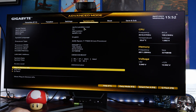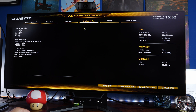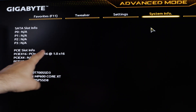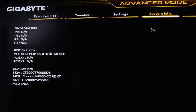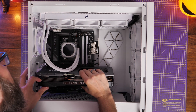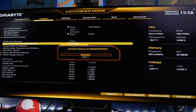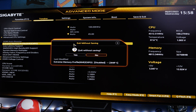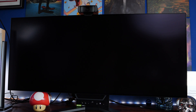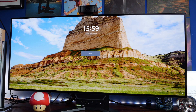If you go into system info, you can also see that despite populating three of the NVMe SSD lanes, the PCIe X16 slot is running at maximum lane speed, which is great. It's worth noting that you only get one X16 slot on this board and it's the top one, so that's where you want to install your graphics card. Basically just make sure XMP is on and then it boots into Windows — I tested it and everything's running as it should be. One other thing to bear in mind: you'll probably want to check for the latest BIOS updates because there have been some problems with AMD boards. I'll link to a Gamers Nexus video in the description on that.